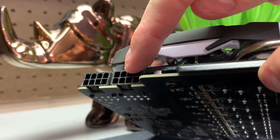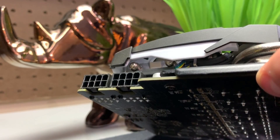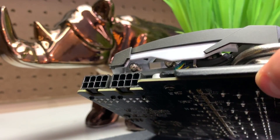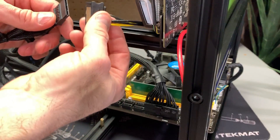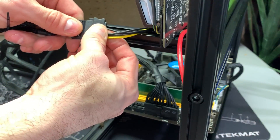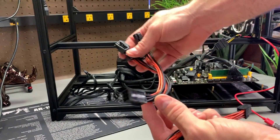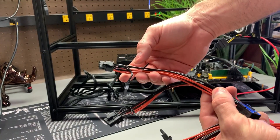For GPU power, some cards only require 6-pin, some require full 8-pin, and some even require 6 plus 6, or 8 plus 8, or different combinations of that. Typically you see it on the higher powered cards. Consult the internet for your card's power requirements. For our 1080 Ti's, because they're power hungry, we need them all, and we'll be using splitters.